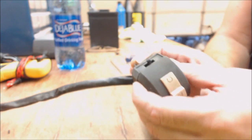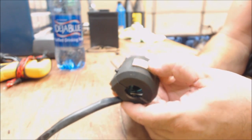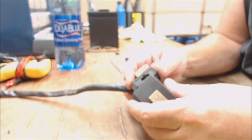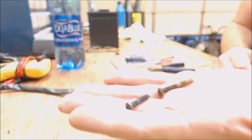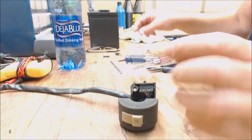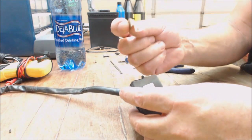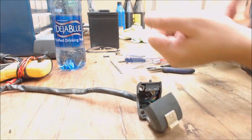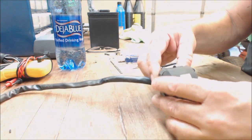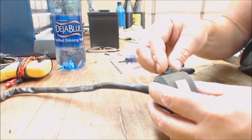So basically, I've taken a switch. You've all seen them. It's got some hard component issues there. This doesn't work. Over time, they get arced, and they don't make contact anymore. So basically, all I've done is I've taken the two screws out. You'd loosen it up, take the hand grip off. If you can't get the hand grip off, you just take the two screws out here and pull all the way apart. And then there's a couple of little screws in there holding a little clip now. I figured y'all could figure that out. I mean, they're very basic. When you look in there, you'll go, oh. So it's real simple.